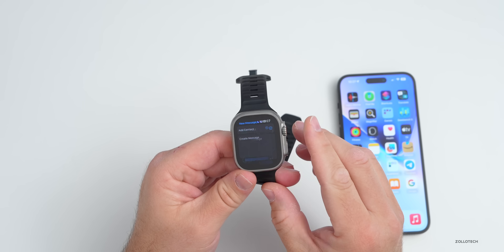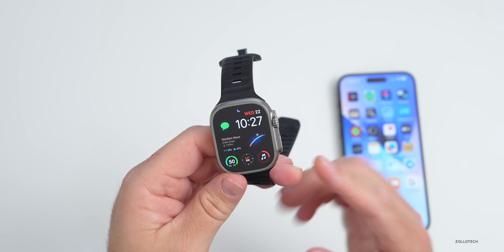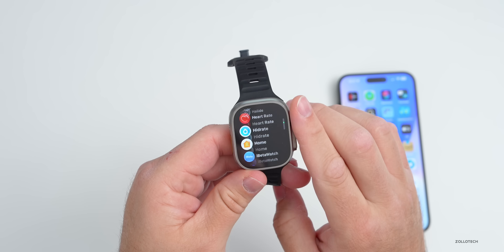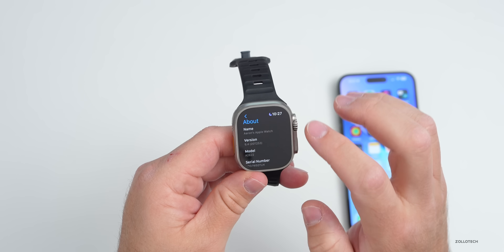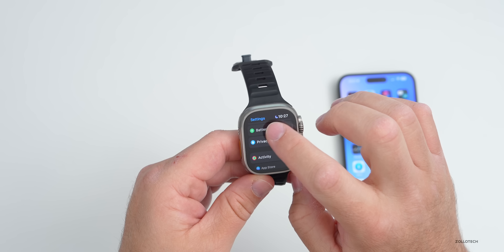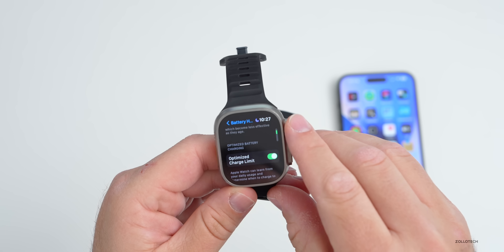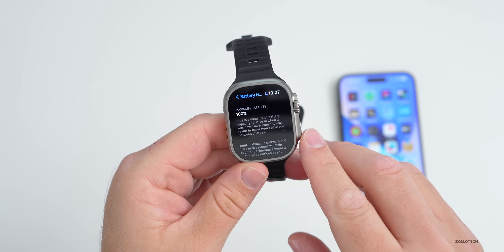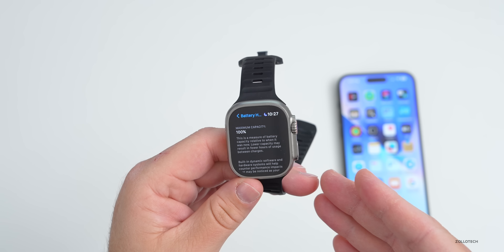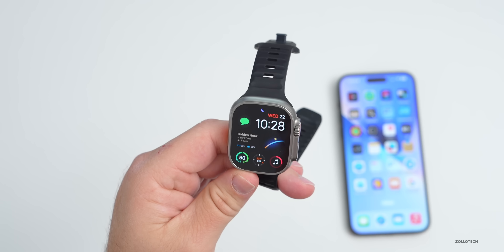There are also some bug fixes. For the Apple Watch Series 6, it will now estimate maximum battery capacity more accurately. Going to Settings, then Battery, then Battery Health, you can see the battery capacity percentage. Sometimes on older watches these aren't accurate. For the Apple Watch Series 6 44mm specifically, it will now estimate this more properly. I'm showing 100% capacity here.